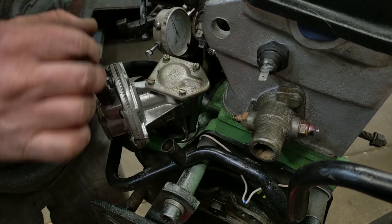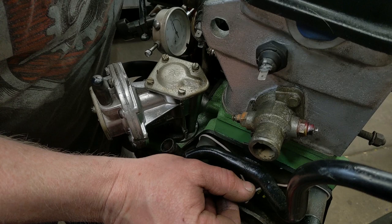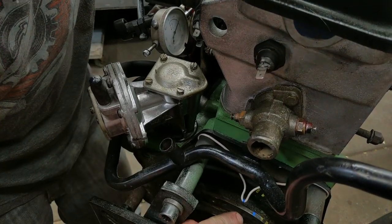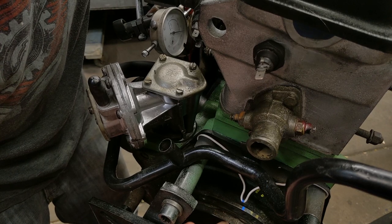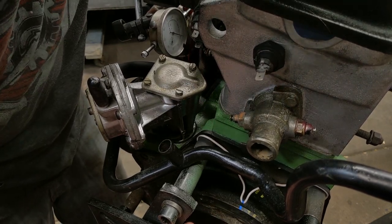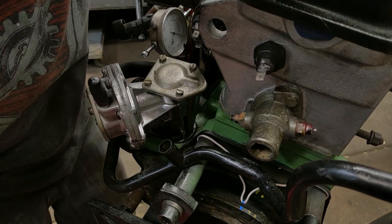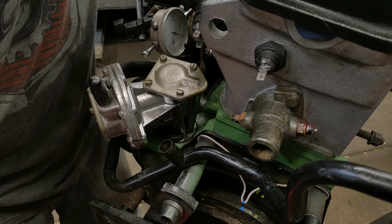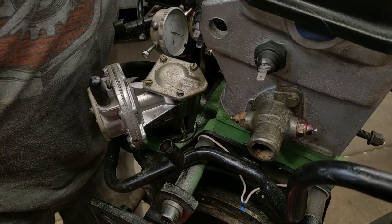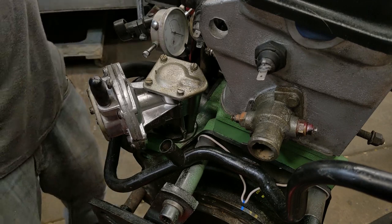but it's set at zero. We backed it off, and then we rotated the direction that the engine would run, and that'll press up, and we come until we hit exact top dead center right there, and I'm at 39 thousandths, which is roughly 0.99/1 millimeter, so we should be good. That's a little over spec.